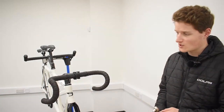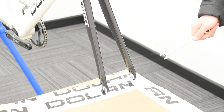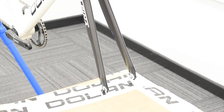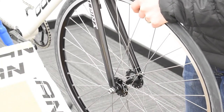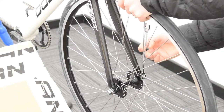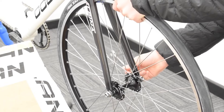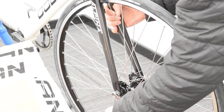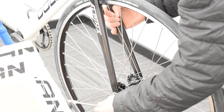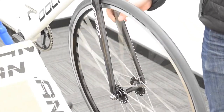Your front handlebars are now nice and secure on the front of your track tandem. Now it's time to attach your front wheel. Take your wheel out of the box and take your 15mm spanner. Carefully remove what's propping your bike up, then slide the wheel between your forks. Using your spanner, tighten both of the nuts up. That's how you attach your front wheel.